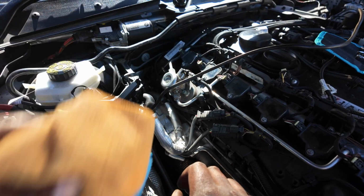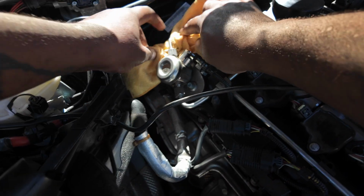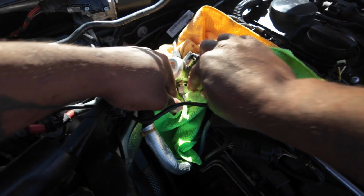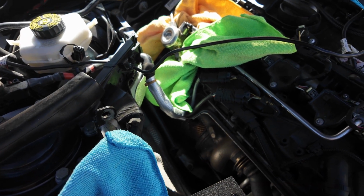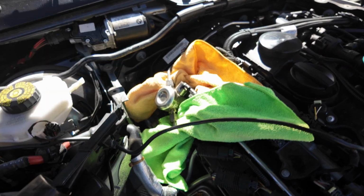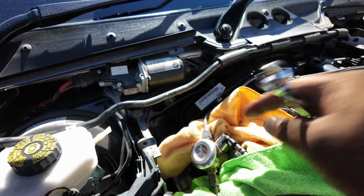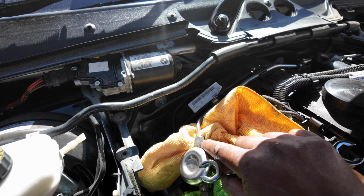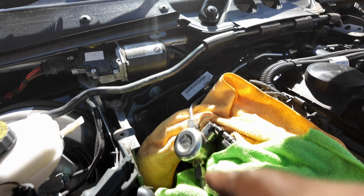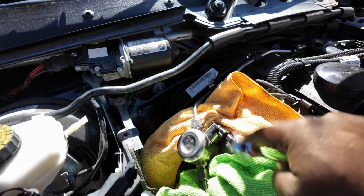I've got a couple of drying rags, so what we're going to do is tuck some underneath the fuel lines, because we don't want that spraying all over our face, and that is another reason why you should disconnect the battery first, because if you were to go and open a door, it would wake the car up and it will spray petrol, and you don't really want an accident like that. So we put those under, and then what I've got here is a C-wrench which goes all the way around, and we want to try and loosen these bolts as slowly as possible, just to take our time, just in case there's fuel in the lines. We don't want it spraying out, so we're just going to take our time bit by bit and get that loose. We're going to start with this rail and go around this way and loosen this bit first, and then we'll disconnect this as well.